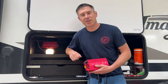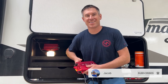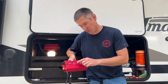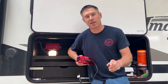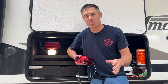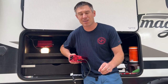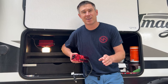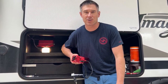Hey YouTubers, I'm Jacob, and this is a how-to video for installing a 500 watt pure sine wave power inverter in your camper. So first off, while shopping for an inverter, you want to make sure you're looking at pure sine wave power inverters. That's really important because a lot of new electronics, laptops, computers, smartphones require pure sine wave power inverters rather than stepped. If you use a stepped inverter with your electronics, they could damage them or render them useless. So you want to make sure it's pure sine wave.